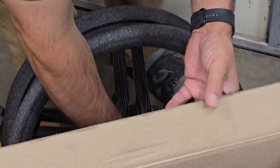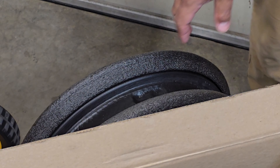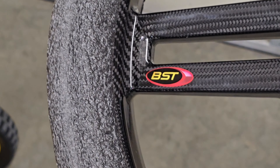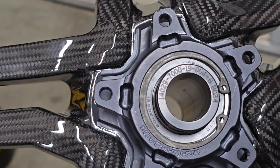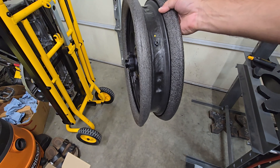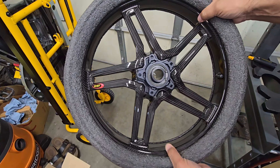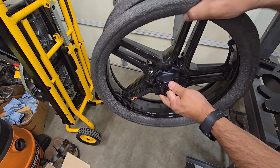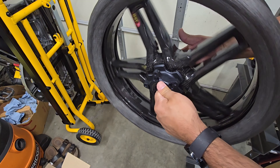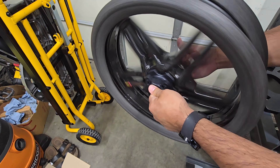Right now I'm going to do a rotation comparison — a before and after. I basically hold the rim and pinch my fingers between the inner race, then give the rim a spin. I get about four or five good rotations before the rim slows and stops. At the end of the video when the ceramic bearings are installed, you'll see just how freely the rim spins and how many rotations I get.